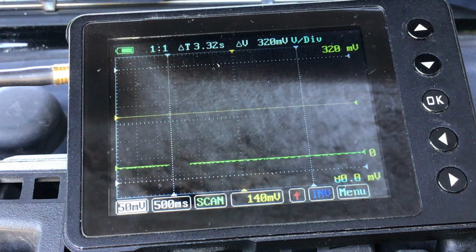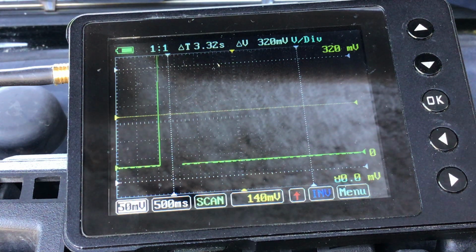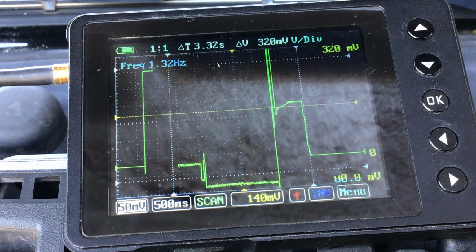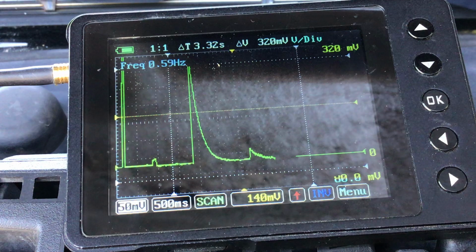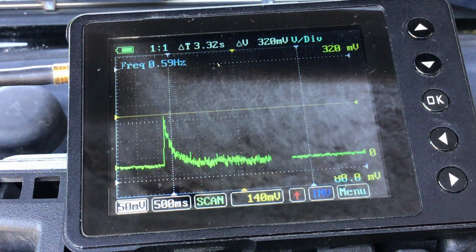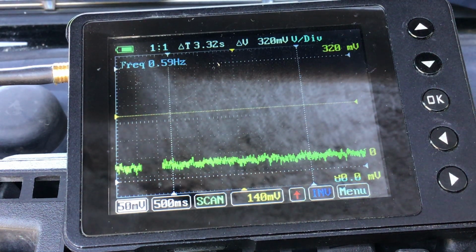So anyway, now I'm at TDC, and I'm going to make a switch. I'm going to take the Pico WPS out of the cylinder. I'm actually going to redo the range. I'm going to shut it off, let it test itself, let it calibrate itself, go through the 1, 2, 3. Now I'll go down to 3. And I'm actually going to go to the zoom because I want a real sensitive setting, because I'm physically creating this pressure by turning the crankshaft. So I'm pumping air manually into the cylinder.